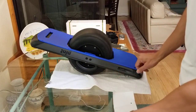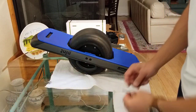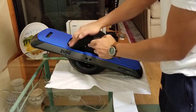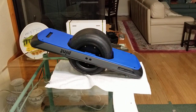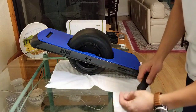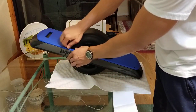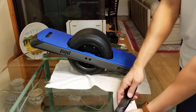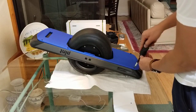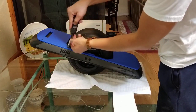I just like to hand tighten these first. Remember, our two short screws are going to be towards the wheel, so we put two long ones at the ends. Then we have our two short screws that go here, and for the short ones also put some Loctite for added safety. Now that these are in the right position, I can go ahead and screw these in. I like to keep these loose for now in case I have to make some adjustments with the plate later.